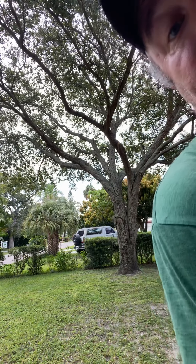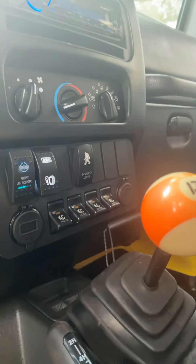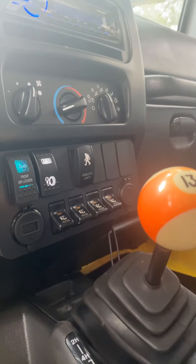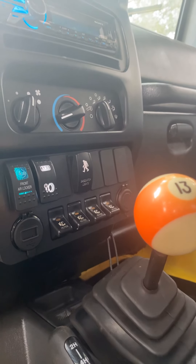So, what the pro tip is — when I turned it all on, the air compressor powered up and it stopped like it should, charged up, was awesome. Let's get our keys, I shall demonstrate. I engaged the locker to test the axle before I went any further, and I was very sad. Now we're on, ignition's on. Turn on the compressor. It should charge up and it should stop, and it should stay that way, according to the manual, for 15 minutes. Then I can engage the front locker. You can hear it clicked, and then it powered up, aired up a little bit more, and it stopped. And it should not recharge for about 15 minutes.